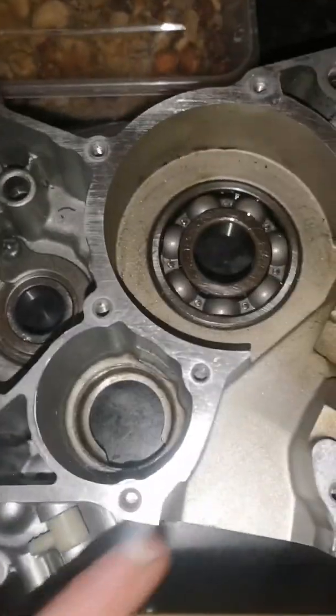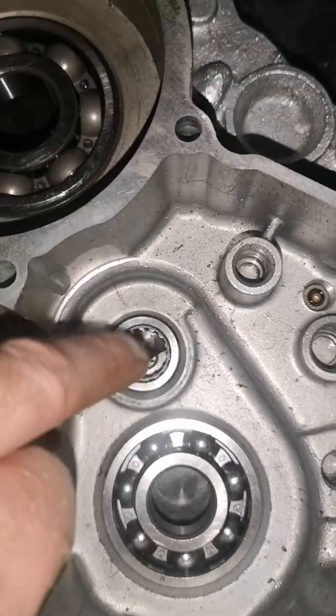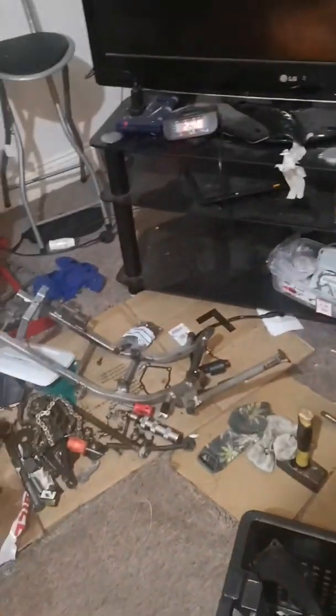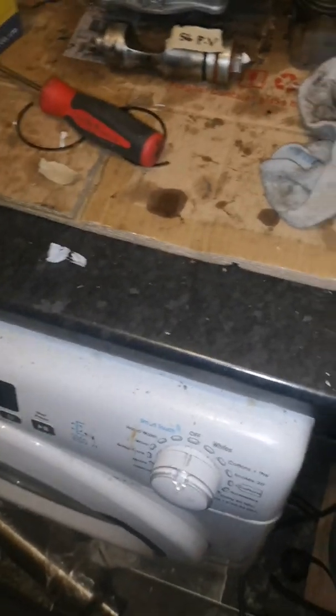On the DTR I'm doing: there's the cases, the bearings are in. I'm waiting for that bearing - I ordered them wrongly, I ordered that bearing the same as that balancer shaft bearing, but that one's smaller. Maybe that's the bearing I was waiting for, the MR1, for £20. The cases are all looking good. I've been cleaning the bike up and ordered some new nuts from Fowlers. All I'm waiting on is this little part that's been painted, got all Yamaha gaskets because I'm selling it on, using all the proper DTR stuff. All I'm waiting for is the oil seals and that bearing - if they come tomorrow, the rebuild video will be up, then the video of it going into the bike, and then the video of the bike running. Thanks for watching.